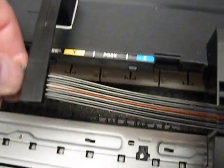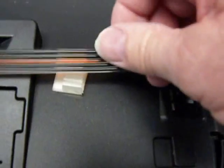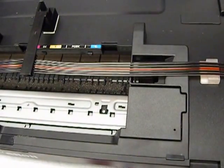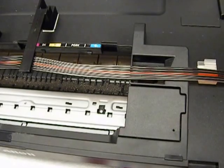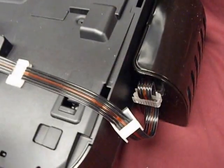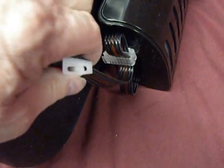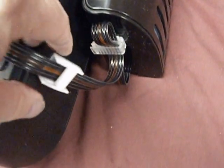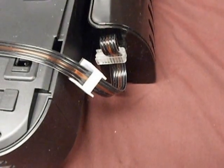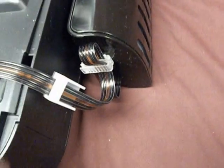Try to push the hose back as far as you can. Get the other hose bracket and place it in line with the hose. Peel and stick it down right about here. I want to point this out — I already balanced it, but I forgot to show you previously in the video. You want to shut off the ink by squeezing this little hose shutoff. That'll stop the ink from flowing so when you're putting it in you're not going to get ink dripping all over. But now that it's in, this is critical — you've got to open it up.